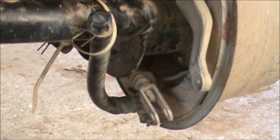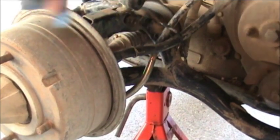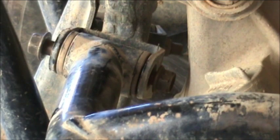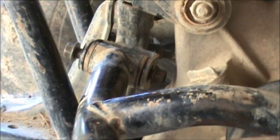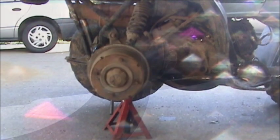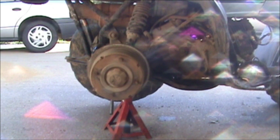Don't forget to hook your brake cable up. Now we got one hose to hook up — go ahead and put the clamp on it like so. Don't forget to tighten this bolt up. Now I just got to throw the tire back on there. I'll turn this around and do the other side — it's the same process, only the other side I don't have to worry about brake shoes or a brake drum, so just repeat the same procedure for the other side.